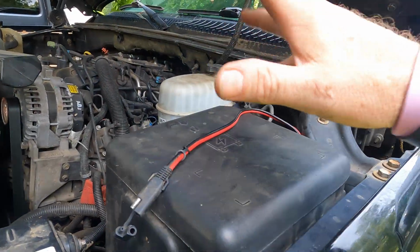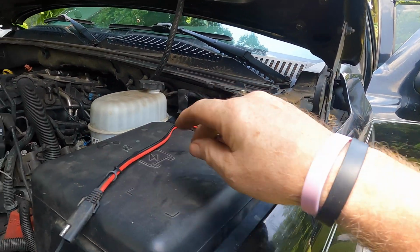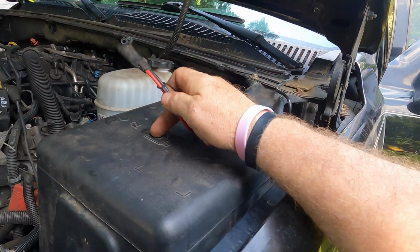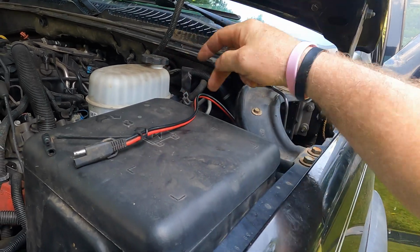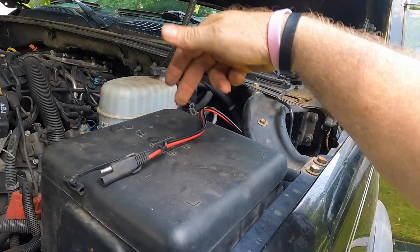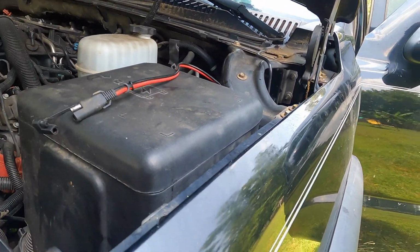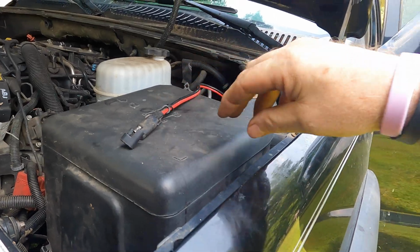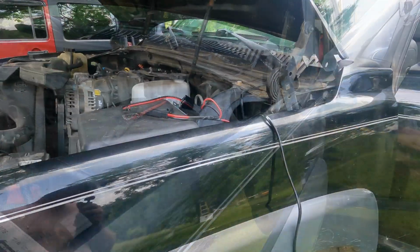All right, I know better than to record stuff like this, because people will tell you 1,000,000 ways that you're wrong. So I was able to tap into the fuse, a 30 amp fuse for this. All I need is 12 volts. I do have a fuse on this, and there's a fuse on it. So that's 2 fuses. Now I'm able to plug in whatever I want here, but I'm going to run it back to the battery, and let's see how that works.